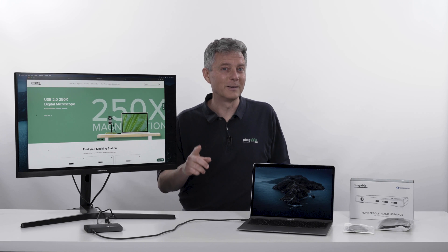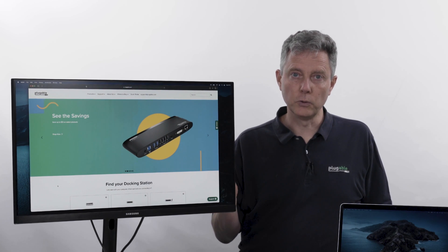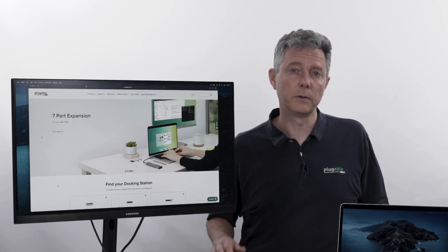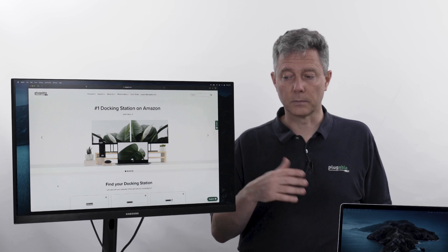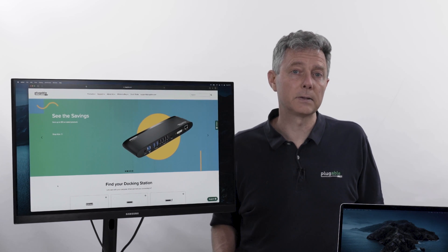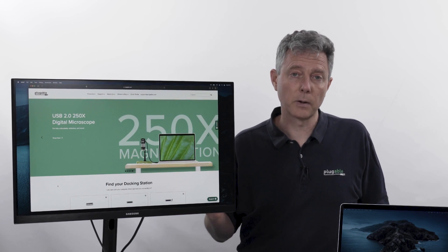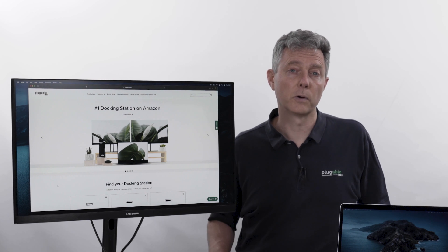But not the M1 case, because with M1 you need to switch to a different technology since natively it only supports a single display. Compatibility on these exciting new Thunderbolt 4 hubs is really good on Mac. On Windows it's a bit more complicated — you basically want a Windows system that advertises Thunderbolt 4 or USB 4 compatibility. A lot of older Windows systems have USB-C or even Thunderbolt 3 and are capable of being compatible, but they need software updates and right now that's still uneven. So for the moment, we're not recommending these Thunderbolt 4 hubs for those older Windows systems.